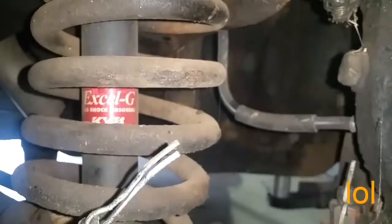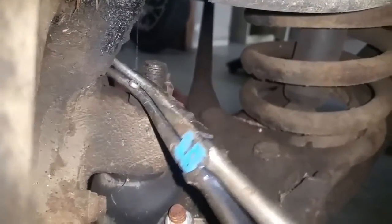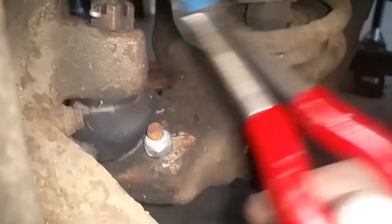So this is actually a long process. For me earlier it took about an hour and a half, so I'm going to make it short for you guys. First things first is I'm removing all the cotter pins. Just want to let you guys know that these are newer ball joints — I had put these on when I first got the car, so they're not quite as stubborn. Something that was a little more original might be a little more difficult to deal with.